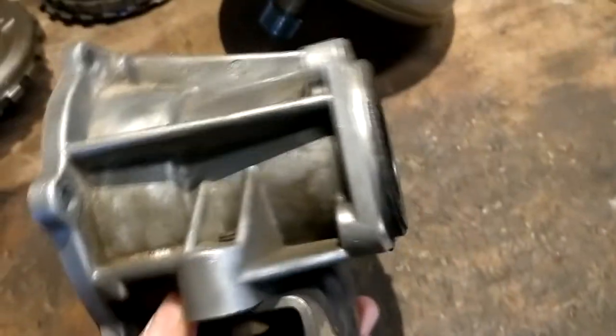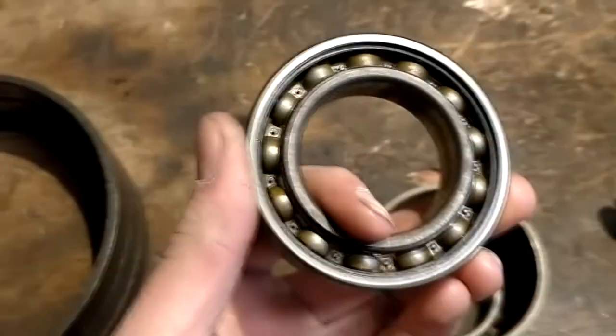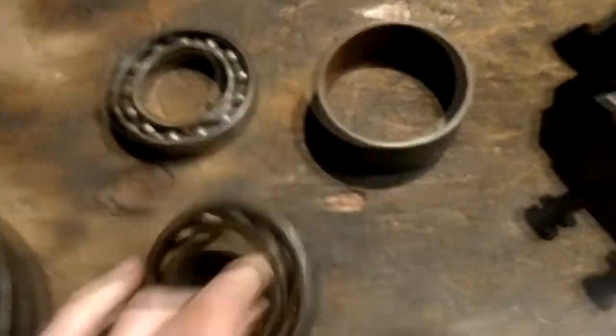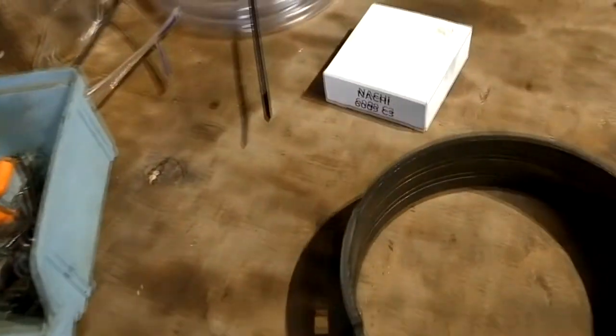This tail housing isn't very common — it only came on these 475s with the rear drum parking brake. This one does still have park in it, which is kind of not common to have both, but this has both, because it wasn't the auto-park style on the newer version. The bearings were fairly tired out — one was kind of okay, but the other was pretty rusty and really crunchy. I got one new bearing and I'm waiting on another. They were the NDH bearing style — L09 — which GM actually owned, and they don't cross-reference to anything, but I measured them at 6009. I got an SKF one coming off eBay.